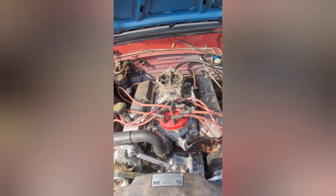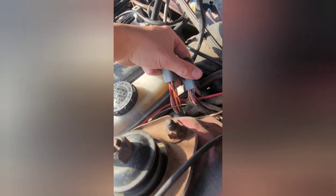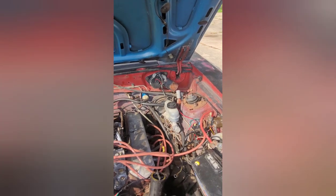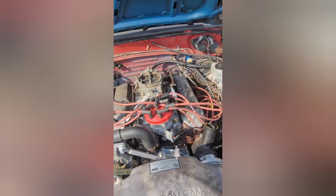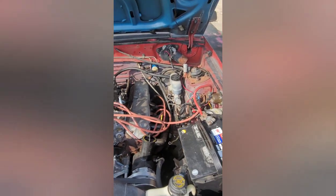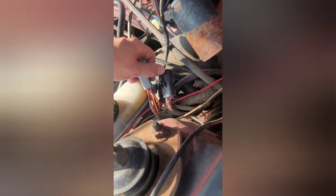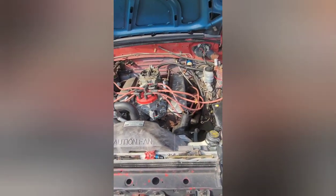This is a nice way to not ruin the car — where no pigtails are cut. Because some people look at these cars and the first thing they check are these two connectors. If you see something cut, even for me it's a deterrent from the car, because now I know trying to put that back together is going to suck. What wiring issues did they have? Was it the body harness or just something going to the ECU? You don't know unless you have the original person telling you why they did it. But this way, you walk up to this car, it's got a carburetor on it, nothing's cut — all the harness is there. You can plug right back into it, put the EFI on it. It's a good selling point.